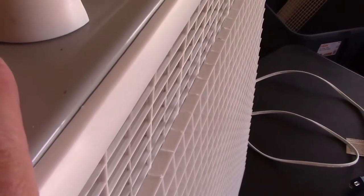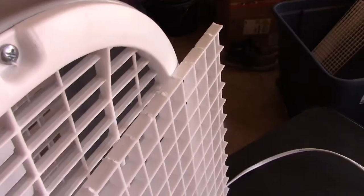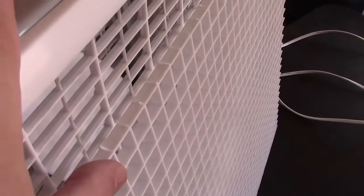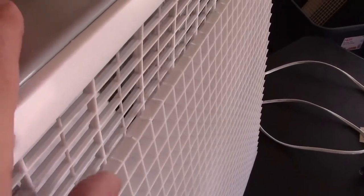Notice that when you lay the two grills together, the outer one we're adding is not touching the inner one — it's just touching the edge because the fan grill is indented, and there's actually a lot of airspace in between the two. There's essentially no way water is going to get in there, because the water will just run down. Water doesn't run sideways or up, so it'll just drip down. It can't make the jump from one grill to the other, so you won't get any water even touching the blades — never mind getting all the way in. So that's really not a concern.